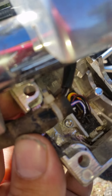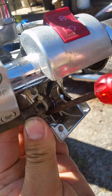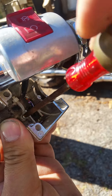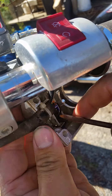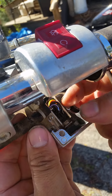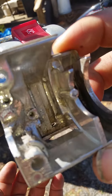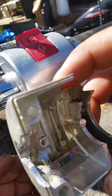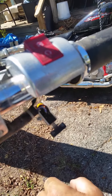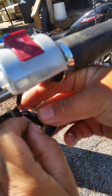You need to unscrew that so you can get the actual start switch out. I only have it in a little bit — I'm gonna take that screw out. Once you get it out, the plug pushes through the housing and the housing comes off by itself. You can see it's dirty, it's got water in it — the bike's been outside in the weather and I think that's my biggest problem. I'm gonna get this screw out so we don't lose it.